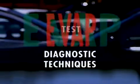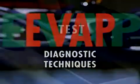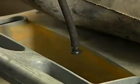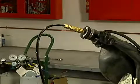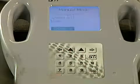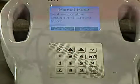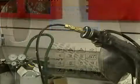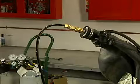Now let's demonstrate some simple diagnostic techniques you can use to pinpoint evap leaks. With the hose crimped or plugged, and the tester hose attached to the adapter, set the tester in manual mode. The tester will now pressurize the evap system for about 10 minutes. While the system is under pressure, you may perform one or more of the following leak detection techniques.